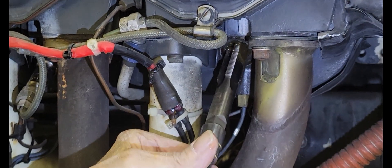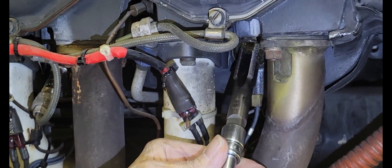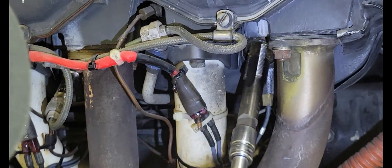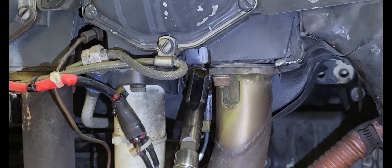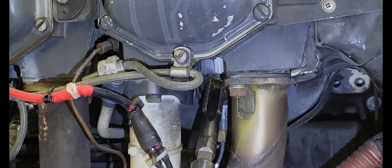He's loaded up the flutes on this to keep the chips from going into the cylinder — that would not be a good day for anybody. We're going oversized because nine times out of ten you can't get a standard helicoil to go tight once the other helicoil's pulled down.